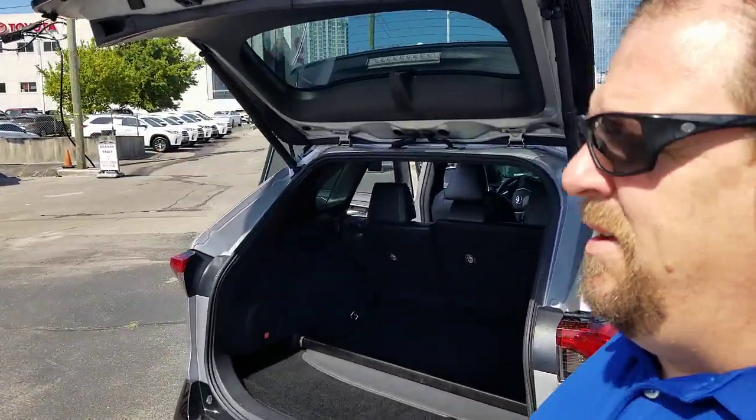Your battery is gonna overheat. You're gonna have other issues with your hybrid systems — could be efficiency problems, could be stuff like that. But needless to say, those vents are there for a reason. Make sure you don't cover that vent or you'll probably not be in a good spot. If your battery overheats, on certain hybrids it can actually put you into a limp mode where it has to be serviced before you can use it. If you're on a long trip, that's not something you want — having to tow it somewhere.